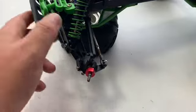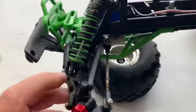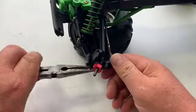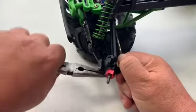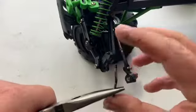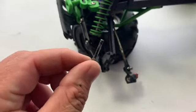On the side that's got the bent kingpin, it should be coming up through here on top, right through that hole, but it's not. The c-clip has already popped off of there, so I should be able to just grab it with a pair of pliers and pull it right out. There goes the clip — and there is my bent kingpin.